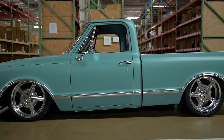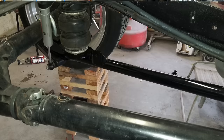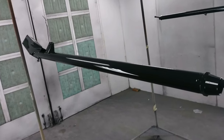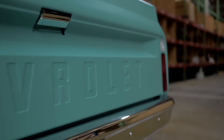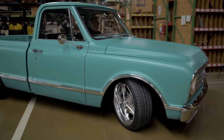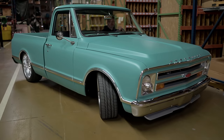I upped it to go with two tanks, two different compressors, release valves, so I can bleed the water out of the lines. Stock suspension geometry, but everything just bolted right to it. In the rear, I went with the Reaction Suspension trailing arms — those are tubular, a really cool piece made by Travis out at AC Pro Performance. It rides just like a brand new car, really like a Cadillac. The truck has about 25,000 miles on it, and about 9,000 miles since the suspension was redone.